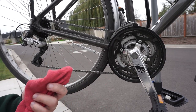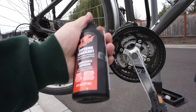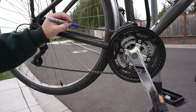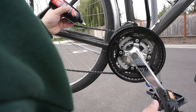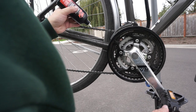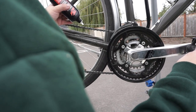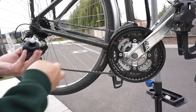I had to go into my cogs a little bit with my brush, which is what you should be doing anyways. And here we go to Tri-Flow — Tri-Flow is a nice lubricating oil I like to use. Pretty classic. You mark your chain with a Sharpie, and then you put one drop for every single chain link. And there you have it — you've cleaned your chain, you've lubricated it, and it's ready to go out on the road again. This is my wet, rainy day commuter bike, so it's got to have that good stuff.